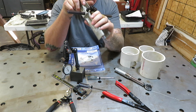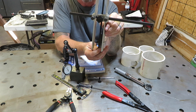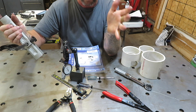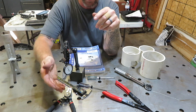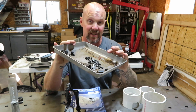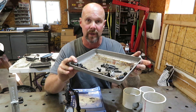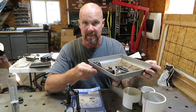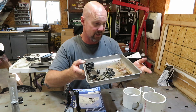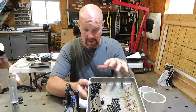There is another tool you can purchase — this is an H gauge. It sits down on top of your casting, you drop this needle down on top of it, then you flip it over on top of your pump and it tells you what your input shaft end play is. I already had everything together so I just did it with the magnetic base and needle gauge. Another thing I found really handy was a couple of trays like this one — I still have some miscellaneous nuts and bolts in it. It's nice to have a tray to keep your miscellaneous nuts and bolts organized. You could also use Tupperware with lids so that if something gets knocked over everything stays separated. This tray was really handy for keeping different nuts, bolts, and small parts separated.